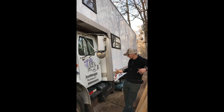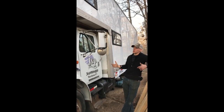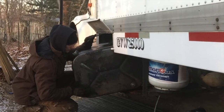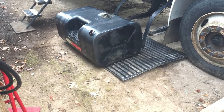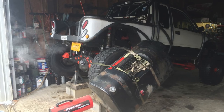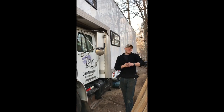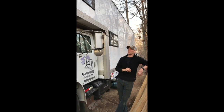The truck came factory with two 60-gallon fuel tanks, which were all rusted out. I ended up yanking the tanks, de-rusting them, and coating them with some red coat, which was not a very fun experience, but it beats buying new tanks. That's also why we didn't make it home the first time around.